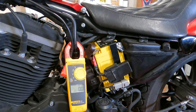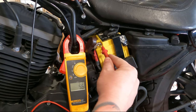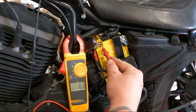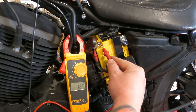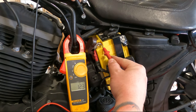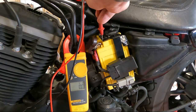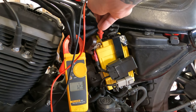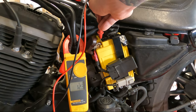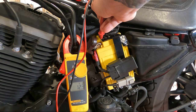Next, we're going to start the bike up and see how much voltage it's producing while it's running. While the battery is running, we're going to check the same voltage — we're sitting at about 12.2, 12.3. That's kind of low. Give it a little RPM. It doesn't climb up, so therefore that means we are not charging.